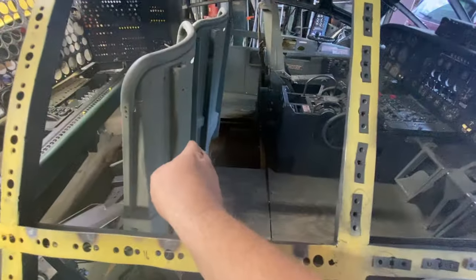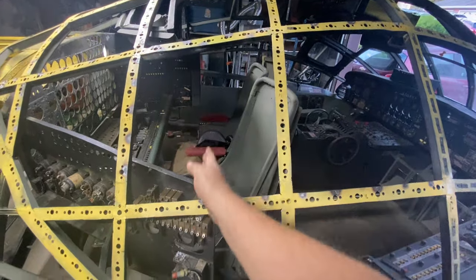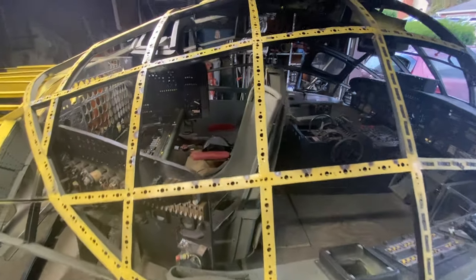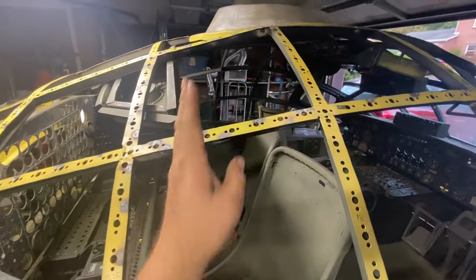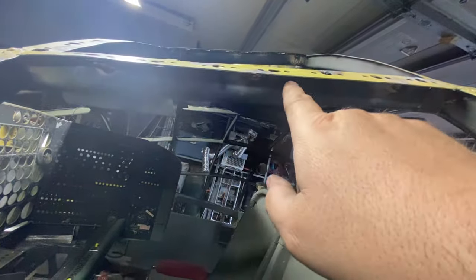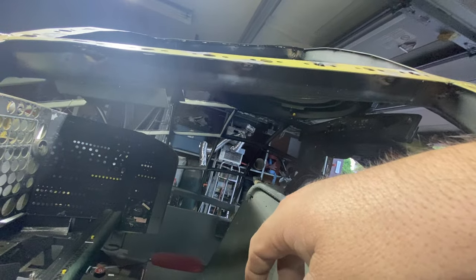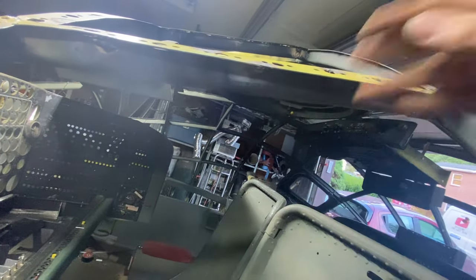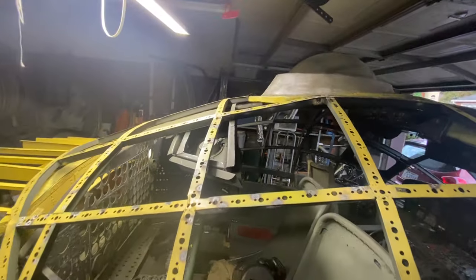I'm building back to 102 inches, so I'm going to have to cut all this in whatever way works best so it can be modular — I can take it apart with simple tools in the field. I'll cut one at a time and make the mounts, probably a couple of holes with a heavy-duty steel or aluminum bar using cotter pins or screws on the visible areas. I'll cover access points with a sheet of aluminum held with one or two pop rivets, removable with a drill.